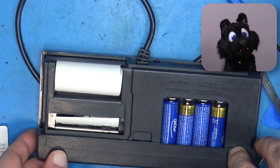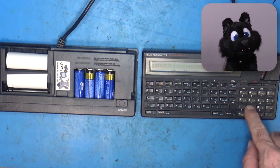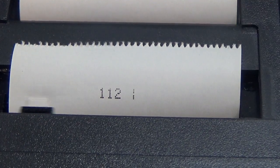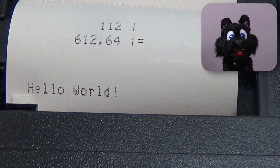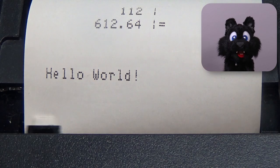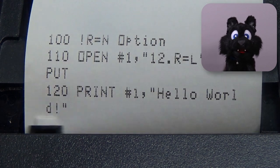After cleaning the case parts I connected up the printer again and gave it a try. Works nicely. It took me ages to find the print key for the calculator though — couldn't see the forest for all the trees. The BASIC part of the device also supports the printer somewhat. You can list your program to it, but if you want to print stuff at runtime you need to open the printer as a file and send stuff over. I would love the usual LPRINT command.